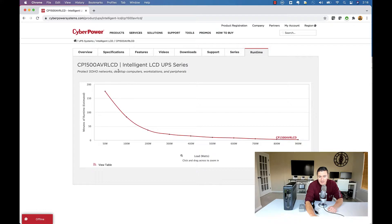It is a 900-watt maximum, as you can see here. They call it a 1500 VA, or Volt-Amps. Basically what that is — if this thing was 100% efficient, we'd be able to push out 1500 watts. But there's something called a power factor. When we do the conversion from DC to AC, that 1500 potential watts actually goes down to about 60%, or 900 watts. There are more expensive units on the market where a 1500 VA unit will actually push out 1500 watts, but this is consumer grade.